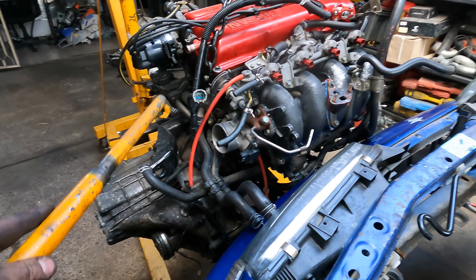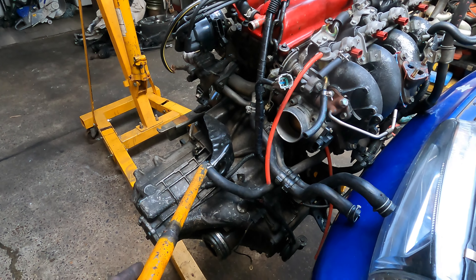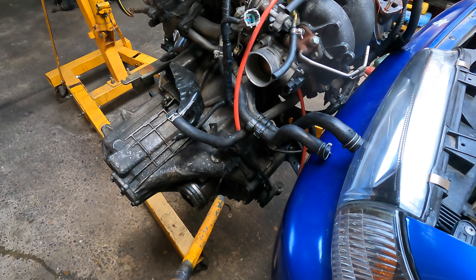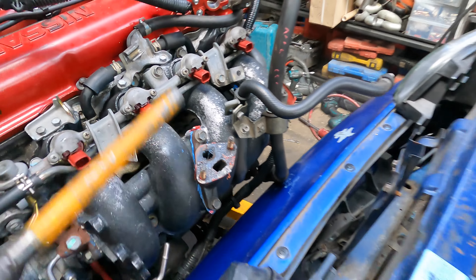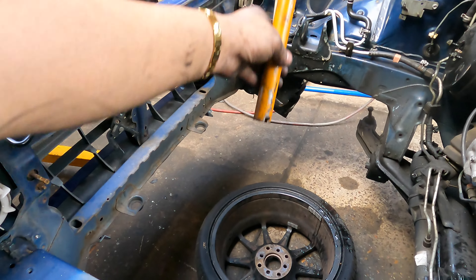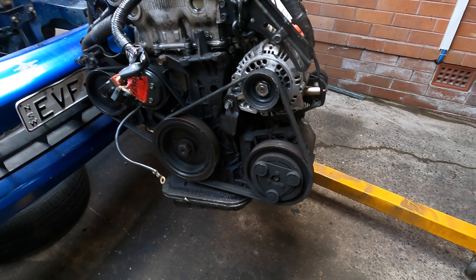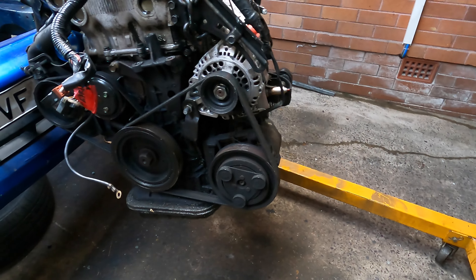Make sure to mark everything and get into the timing position before you remove all parts. Fix all the wire loom, remember all that, don't go wrong. The CC gasket is leaking - they didn't do a good job there. Later when you put it on the car, do those two on that side and then we can pull it out. Take some photos before you strip everything out.